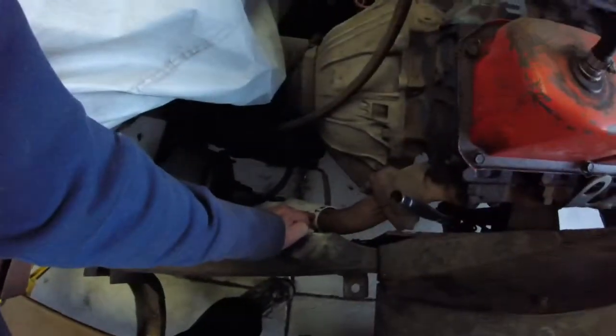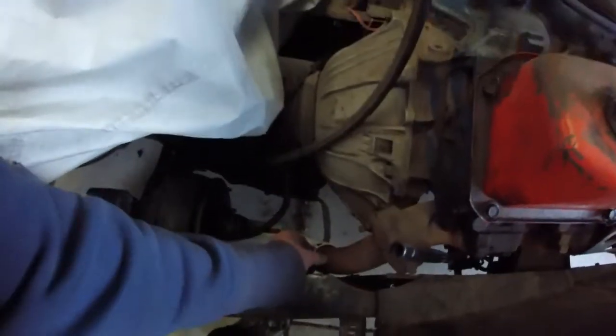But yeah, I'm trying to run this on this side of the brake booster, which will run it directly into the pipe. Now this little bit of PVC that I've got, I'd actually need this to be about 20 millimeters longer if it was welded to this outlet. So when I go and see the exhaust guy, I've got to say, this is what I want, but make this part here 20 millimeters longer. So that's what I've been doing with the exhaust. I've pretty much got it all worked out, lengths and everything like that.